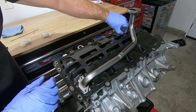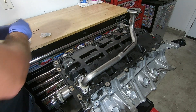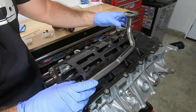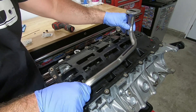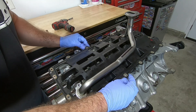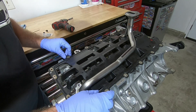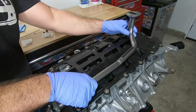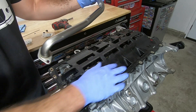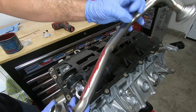The taller hex seems to fit really good, so I'm going to put in some M6 by 20 bolts. What I noticed when I bolted this pickup tube down is it's pushing down on the gasket, which kind of spreads it apart and pushes these bolt holes away from where they need to be — it'd be kind of a pain. So I'm going to put a little bit of grease on the bottom of this thing and bolt it down again to get an idea of where I need to clearance.